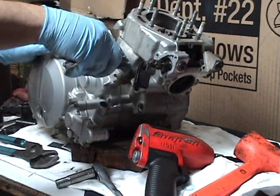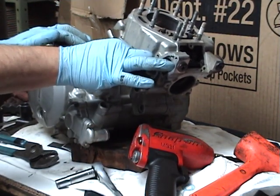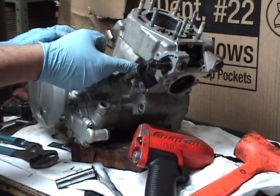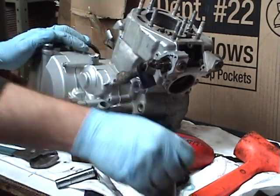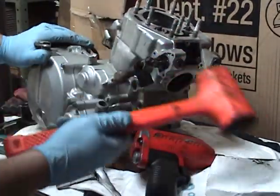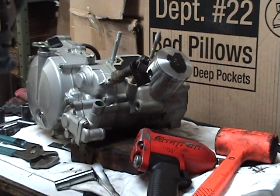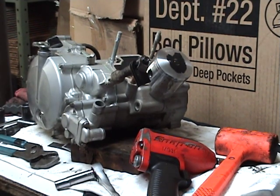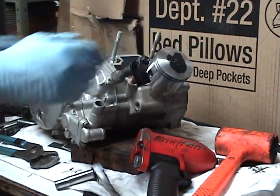Definitely going to need some 12-point wrenches in places, like this nut. Nice not having cooling fins, huh? Usually just a couple taps pops them off. Well, could tell you stories about some of them though. The late model KX gave me the biggest fit of all. I bet it took me an hour and a half to get the jug off without ruining it. Wasn't much fun.